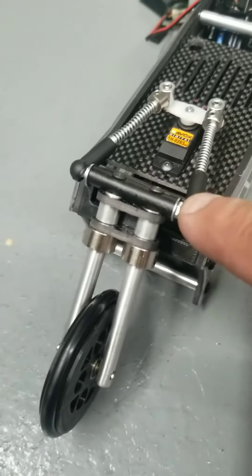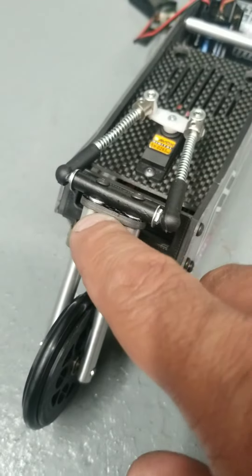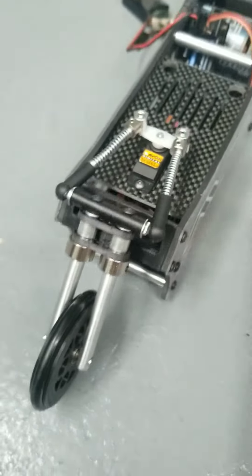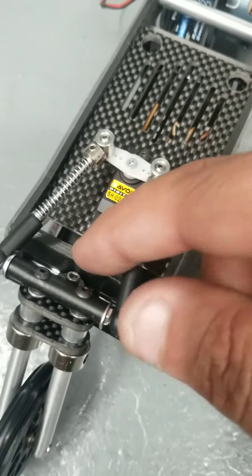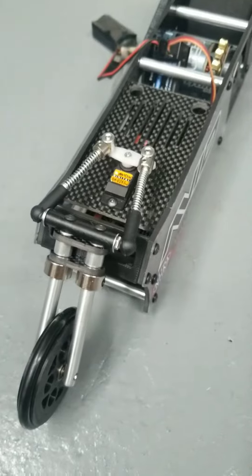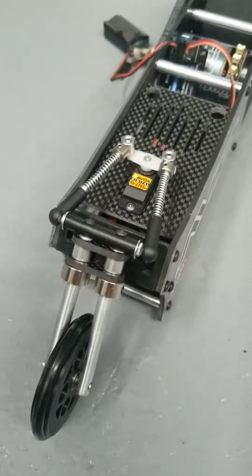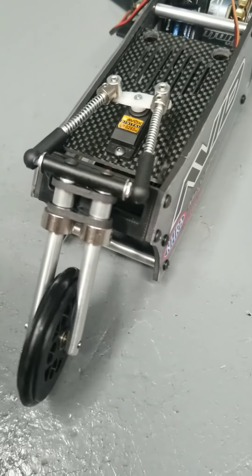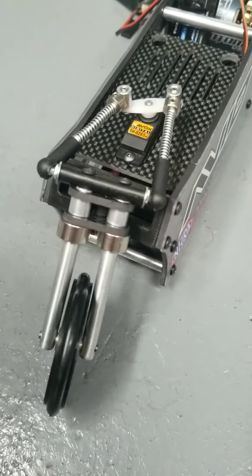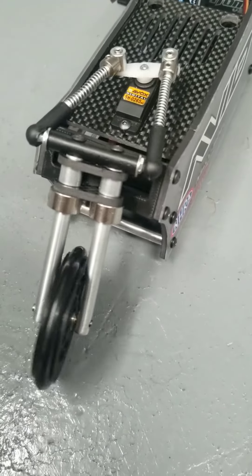Put a slight little bit of lube on the ball cups. Some lube down in your triple tree where it bolts on, and put some lube between the two triple tree plates. Those go through two steel bearings for a smooth pivot. You basically want to lube everything up, make sure you've got a free range of motion, nothing's binding — and this is the result you're going to get right here.